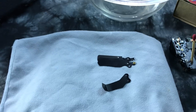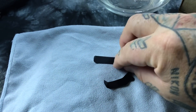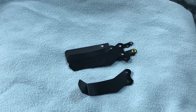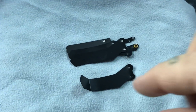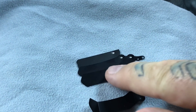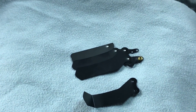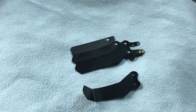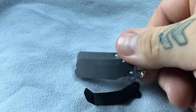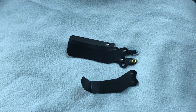If you get dust inside your camera and you're worried about a dusty sensor, you shouldn't be — it's super easy to clean your sensor, and you're never actually touching the sensor itself, just the cover glass. What you should worry about is when these curtains are actually reciprocating. You have two curtains in your shutter mech, going back and forth over each other at 10 or 20 frames per second. The Teflon coating is there to reduce friction and wear.